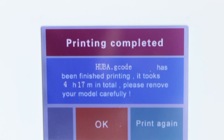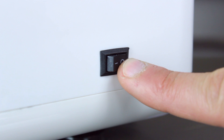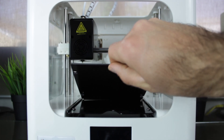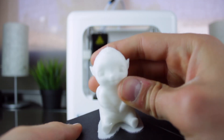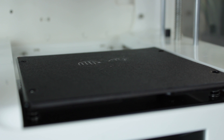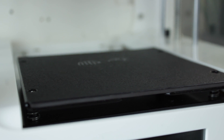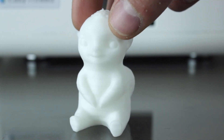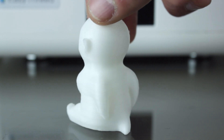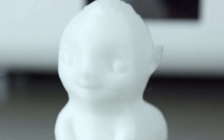Once finished, a print completed message will appear on the screen and we can press Print Again or press OK to go to the main menu. We'll turn off the 3D printer by clicking the power switch, then remove the print bed and bend it to remove the 3D printed object, then put it back in place. As you can see, it has some white marks in the rubber-coated surface because the bed is not properly leveled. To level it, we'll pick up the provided Allen key and adjust the height of every corner of the bed, getting a nice and even surface. This is the Huba 3D model included in the SD card — it looks like a scary, weird baby. But as you can see, the print quality overall is very good and the finish of the surface is very smooth. Now I'm going to show you some prints I've made with this cool 3D printer.